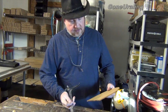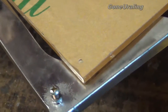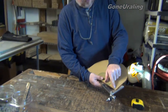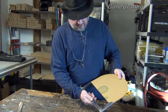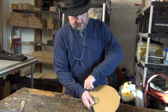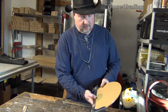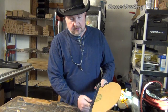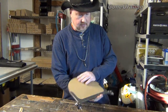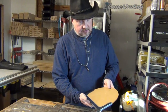I really want to get this installed. One thing I did notice is that the set screws just pinch into the plexi, and I want to think about that. I may actually drill a hole — or at least a partial hole — so the screw will bite into the plexi a little more securely, because if it loosens up or if you try to over-tighten it, it might crack the plexi. Belt-and-suspenders approach: I may drill a hole, put the screw in, and add a little Loctite so it will never come off and fly up and hit the dog.